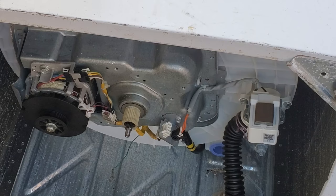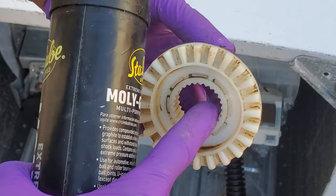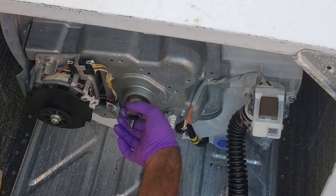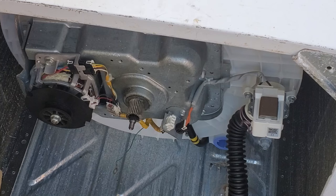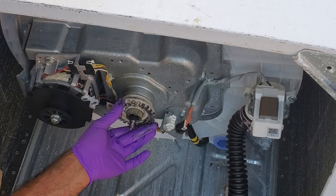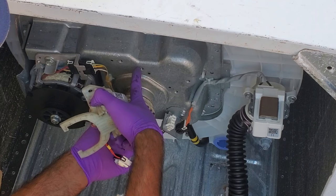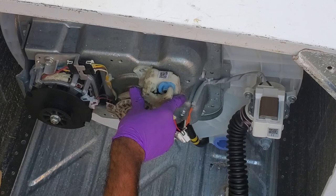I'm going to be greasing up the clutch using some extreme pressure grease around the outside and the inner teeth. We've got the clutch all greased up. I'll also be applying some grease to the transmission shaft. Then we're going to slide the spring back on, and the clutch goes on top of that — it will just fit into the teeth. After that, we'll install the shifter. It's got these two pegs which go into the holes right here, and that will also line up the mounting holes. Then you're going to have to hold it with one hand while you tighten down the bolts.